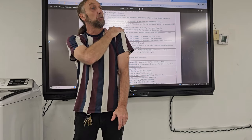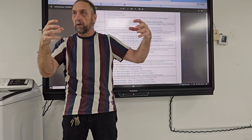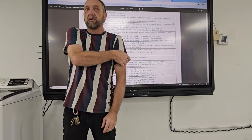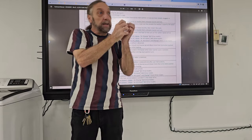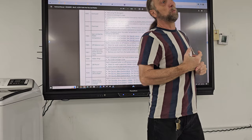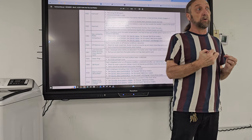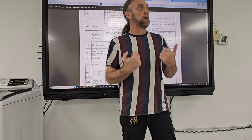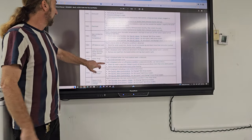So how do we create this curve? They set it on a mannequin or type of mold, and they heat it to form that mold. So if we spin at a very high temperature with hot water and permanent press clothing, that could cause that sleeve to all of a sudden be like this, and it lost its curve because that hot water heated it up and then deformed the clothing. Now the other thing is, like I said, the clothesline: when we spin with hot water and then the machine stops spinning, that causes wrinkles to set into the clothes, especially if a customer doesn't take it out right away. So if we do it in cold water, it relaxes the fabric and reduces the amount of wrinkles in clothes during the spinning cycle. That's why most of them use cold water, okay?